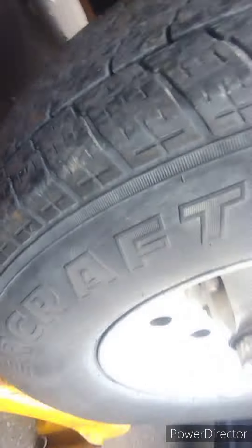I can go ahead and give him those details on what he'll need. Going to the front, half of this vehicle is actually in pretty good shape rust-wise on the frame. But there is the driver's side, which is all rotted on the actual cab mount under the driver's floorboard. On the passenger side, it's looking really good. I'm also looking at the brake hoses, U-joints, and cross-members — everything you can really focus on to know where you're going to try to help this truck.